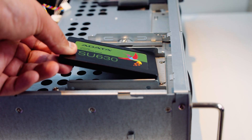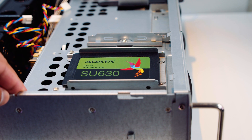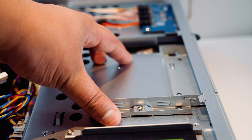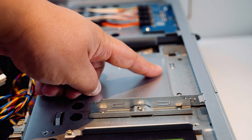There's space for one 2.5-inch drive. I'd recommend putting an SSD in here for system storage because your server motherboard might not have an M.2 slot. There's also space for a slot-loading DVD or CD-ROM drive, or a low-profile one. I won't be using this, but if I do it'll have a CF or SD card reader in it.